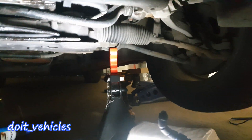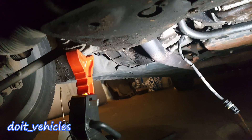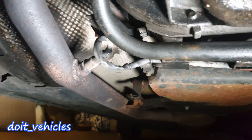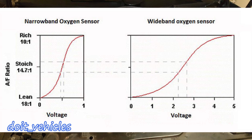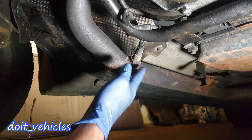The most important oxygen sensor is before the catalytic converter. On this car you have to lift both front wheels and remove both plastic covers. Then you will see the oxygen sensor on the exhaust pipe. This is called a narrow band oxygen sensor because it is able to read only rich or lean condition — it's the type of sensor used on many older vehicles. There are also wide band oxygen sensors, used more on newer vehicles since there are stricter regulations about emissions.